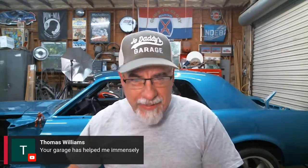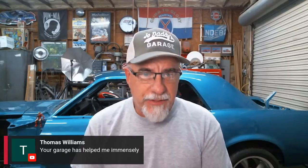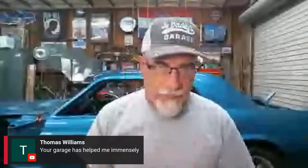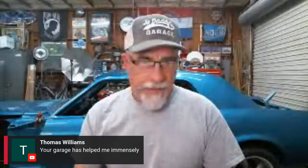I need a little bit of coffee. So as you can see behind me, I've moved Jade to the main shop. This allows me to finish a couple things in the back. I need to get the trunk seal on the deck lid, and then I need to finish color sanding and buffing the deck lid. I'll do a little work on the valance panels, make sure they're right. And then I can get the deck lid on the car and move forward.